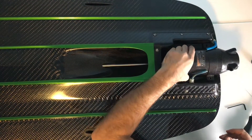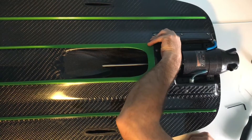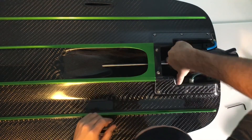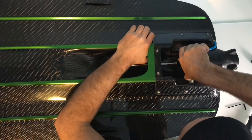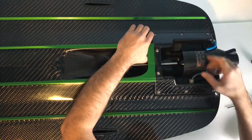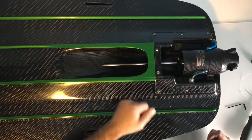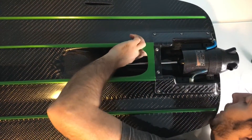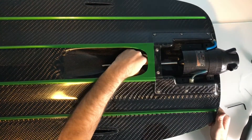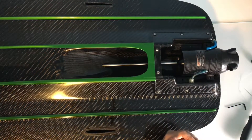In reality, if the only problem is cavitation, that'll give you enough room to clean up all that old silicone around the inside of the board and on this piece. What I like to do is apply some tape on the part where you're actually going to seal, so when it's all siliconed together I can remove that tape and have a nice clean line. I also put tape on the inside of the impeller so there's no silicone inside the impeller, and the same on the inside ring where the water comes into the jet. When I'm done I pull off the tape from those three areas and it should look nice and clean with no more cavitation issues.